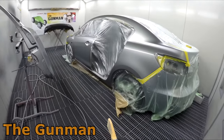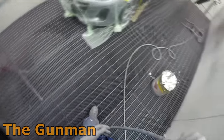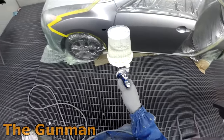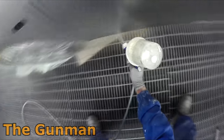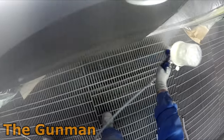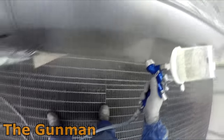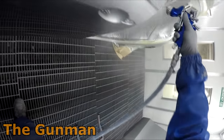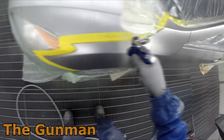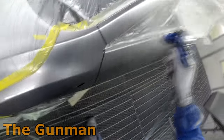One area where solvent is most likely going to win is drying times. You can see me using a duct fan to help dry the waterborne base coat. I've got some improved air blowers coming from Spray Guns Direct early next week, so I hope to have them in videos next weekend. Another review I'm hoping to get edited up is of the SATA RPS pot - Spray Guns Direct sent a box of these for me to do a review versus the PPS system. There are a few advantages of the RPS over the PPS - the main two points are flow rate and cleanliness, since it's a fully disposable system without the hard pot or outer casing of the PPS. We'll focus on that in the review.